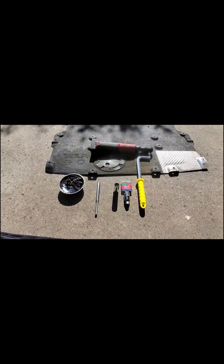We're under the car and here is the front differential — this massive guy here. Here is the drain plug, 14 millimeter just like the rear, and way up here in between everything is the fill plug. So you have the fill plug trapped in here and the drain plug trapped in here. So how do you get to them? That is what I'm going to show you next.